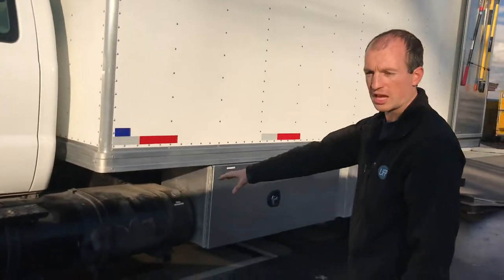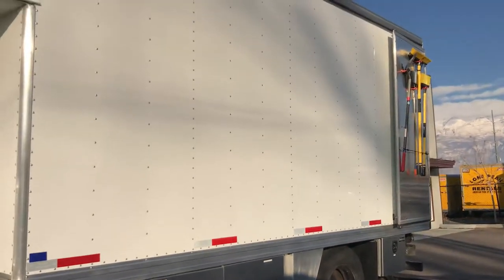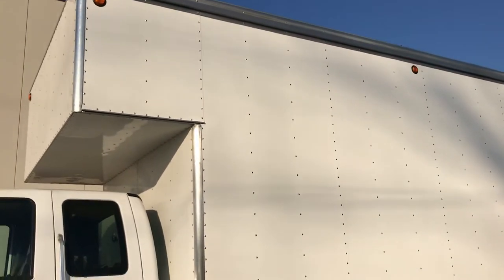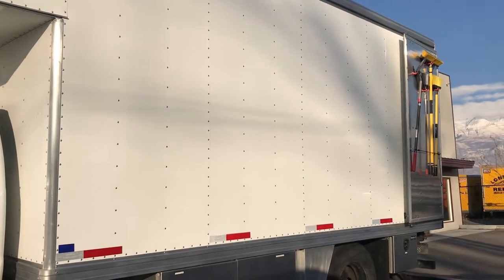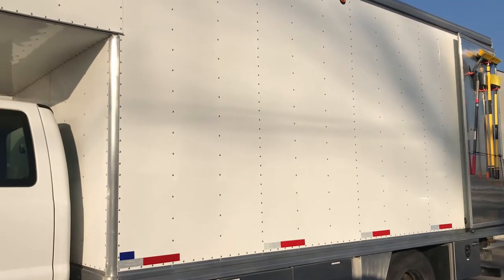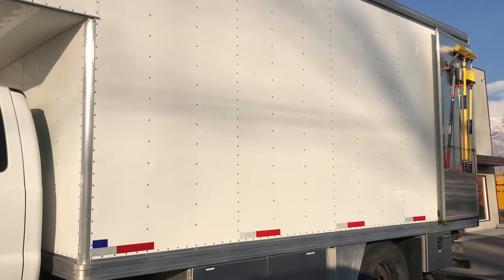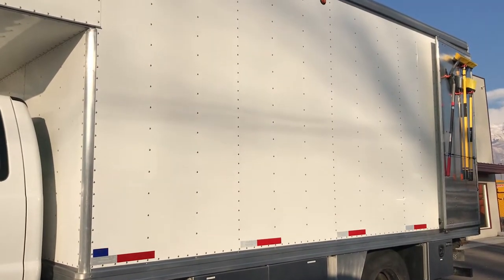You've got two 50-gallon tanks of diesel so you've got a lot of range for traveling. The box is 18 feet long, eight feet tall, and eight feet wide, and it's got a 32-inch attic so you've got enough space to put 20-foot hardware and 20-foot pipe — this package even includes a 20 by frame with hardware. The nice thing about it being a little bit shorter is that it's easy to take around town, easy to find parking, you're not super long, and also this does not require a CDL in order to drive this truck.